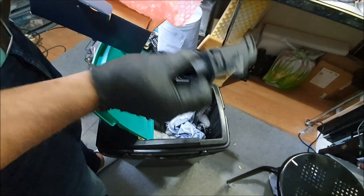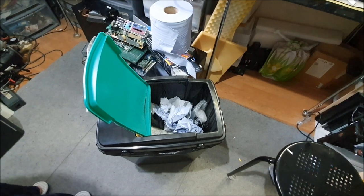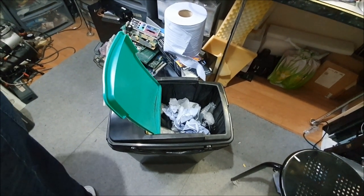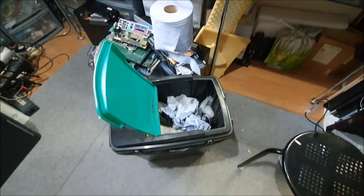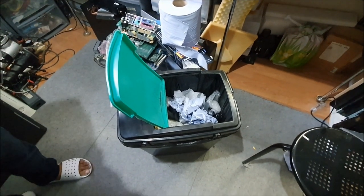That's the module. So you know what I'm talking about. There's a handful of work that needs to be done. The difficulty is that these are not too bad. Taking the manifold off, changing these crank breathers and things like that, they're not too bad. But when it comes to the ABS pump, the trouble is that it's lengthy work, because you've got to bleed the system out, basically.